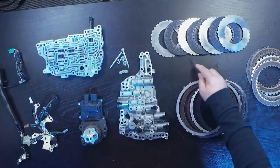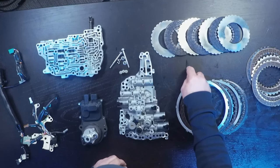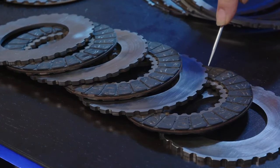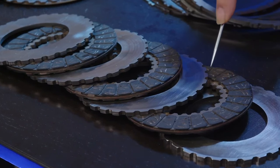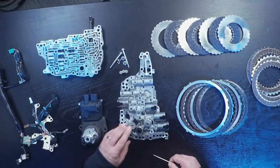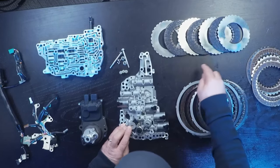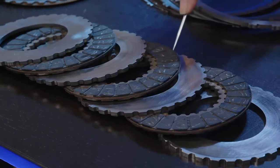The C1 clutch is what I have right here. It is a dry clutch mounted inside the traction electrical motor, between the engine and the transmission. This C1 clutch solenoid will apply this clutch hydraulically, but the clutch itself is a dry clutch — there's no fluid going through here. When this clutch is applied and the traction motor kicks in, it will start the engine.